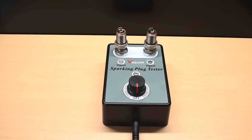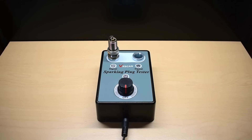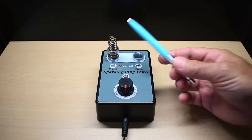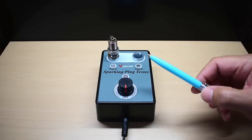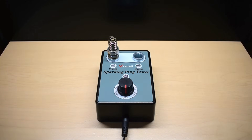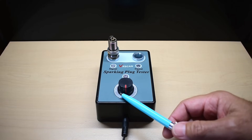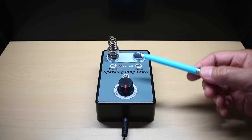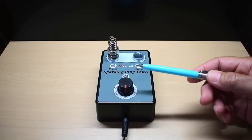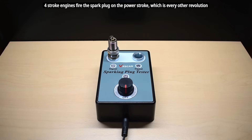The tester does work, and it works extremely well. When I played back the video of the sparking at the lowest setting, it appeared to show 9 or 10 pulses per second — so 9 times 60 is 540, and 10 times 60 is 600 — right around 500 to 600 pulses per minute. That would be for a two-cycle engine. Two-cycle engines have one pulse for every revolution of the engine, while a four-cycle engine has one pulse for every two revolutions.